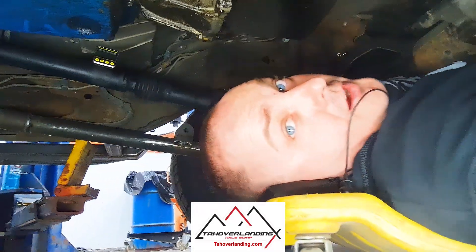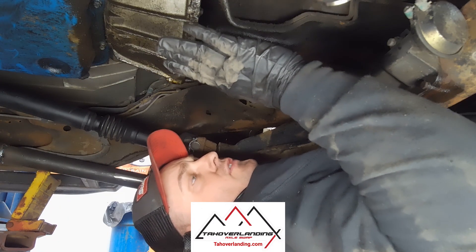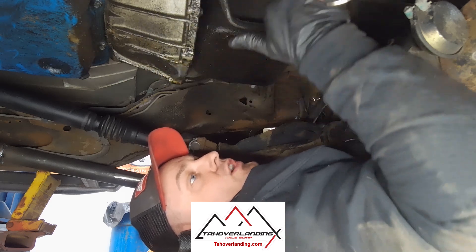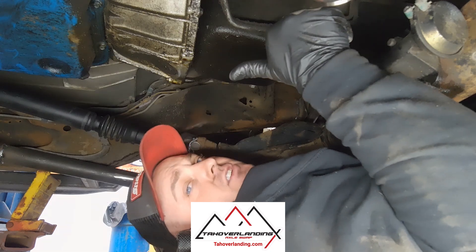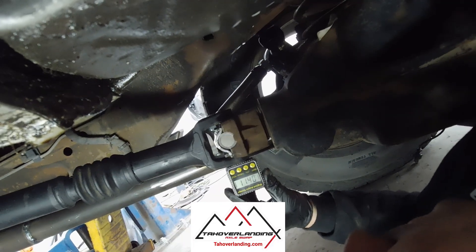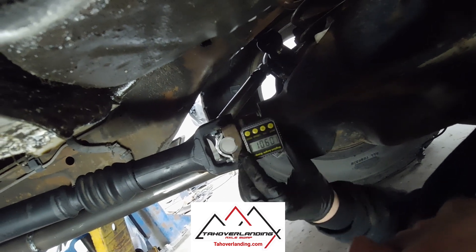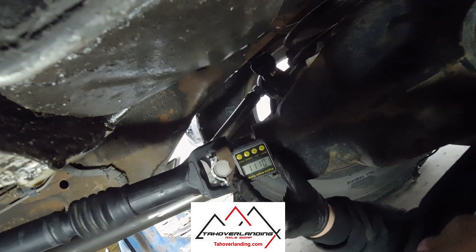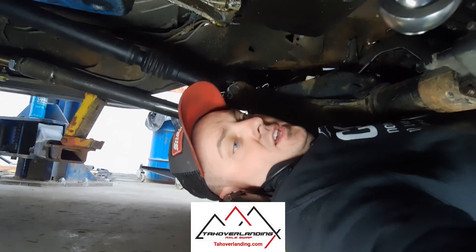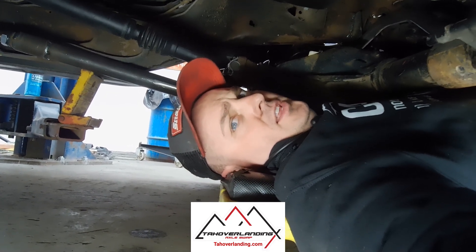Let's see if we can shallow that up a little bit. I'm spinning that upper locating arm — I've got the other one completely removed for now so I only have to adjust one at a time. When you do this, try to get within half a degree. If you're not going to be perfect, try to have it pinioned down slightly, because that's also caster angle and a little extra caster doesn't hurt anything. It looks like 11.4 on one side and 11.1 on the other — I'm going to call that good enough, that's perfect. We're within half a degree. If it vibrates when driving, we can hop out and adjust it.